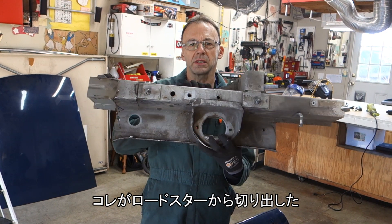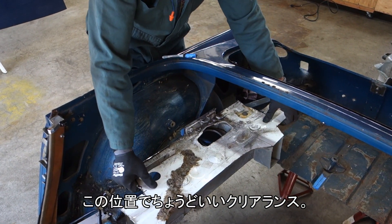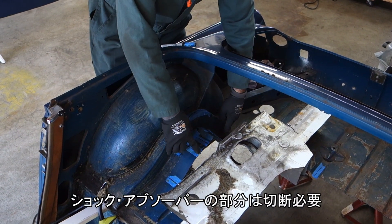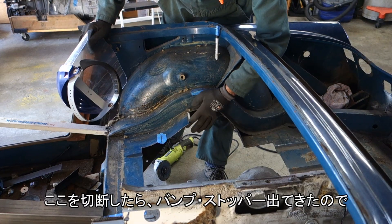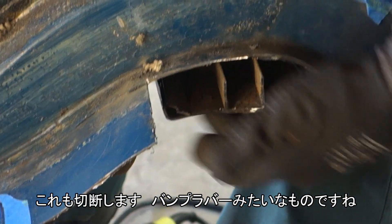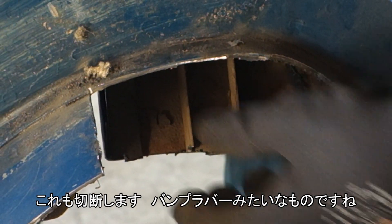Cut out of the Miata, this is the rear subframe connection, and it's going to sit right about here. It's almost perfect — we don't even think we'll have to cut into our midget unibody frame. But we do have to cut this section out so that we have space for our shock to come up. After we cut the space for our shock tower, we realized that this bump is completely in the way, so we're going to cut this bump all the way out. I think it's what the rear end rubber bumpers used to hit up against.